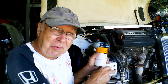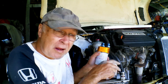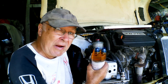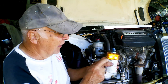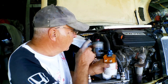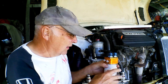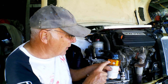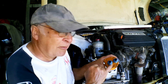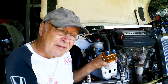I also found where the water leak was that caused the overheating. I had a temporary radiator in there and the hose just wasn't on properly. So I found the causes and I know how to fix them. I'll be fitting an oil pressure gauge, since I couldn't see the factory one on the day because of the sunlight on the dash — it's just a little warning light. I'll fit a proper gauge, a water temperature gauge, and I will engrave 'in' and 'out' on the filter mount so I never have this problem again.